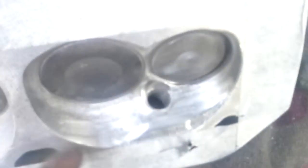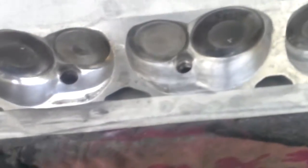Here's a good representation of a halfway done combustion port. It's got a lump there still, a little edge. This needs sanded right here, and these little guide machine marks need sanded too. It kind of goes in stages of progression — that's how I've got it right now.